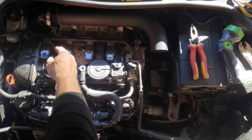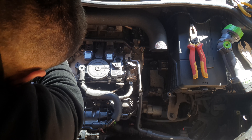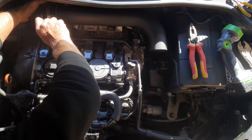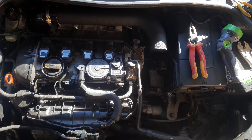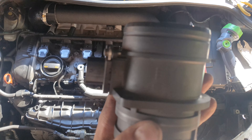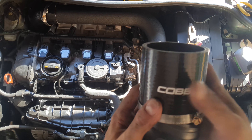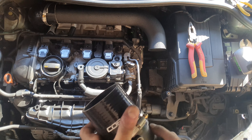Here I'm rectifying the mistake I made earlier — removing the zip tie. Looking at the pictures in the instructions, it doesn't even look like they put anything on the PCV adapter area — it looks like they just fit the PCV adapter into the silicone hose with no clamp. It is pretty snug so it could stay like that, but I wanted to reinforce it, so that's where I put the slim hose clamp from the breather valve.